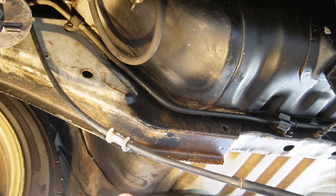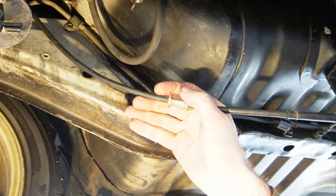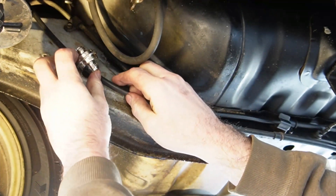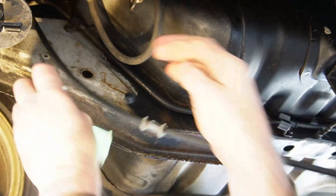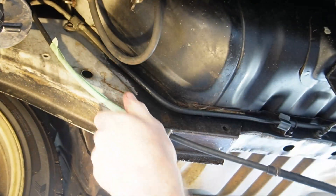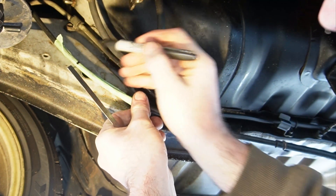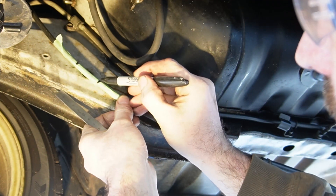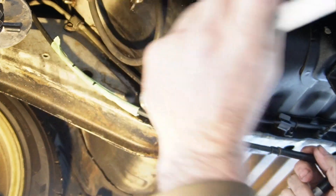Now that our cable has been relieved and we've pulled the drive out, the best spot for my setup is going to be to mount this up here because I have a thread in my chassis where I can make a bracket for this little device later on. I'm going to cut my cable around about here — I've got some masking tape that I'll put on the cable and mark out the 40 millimeters. Then I'll just get the grinder and knock that section off.